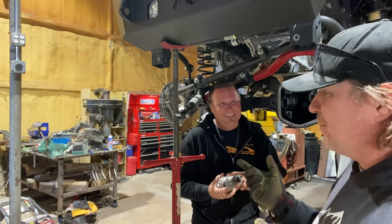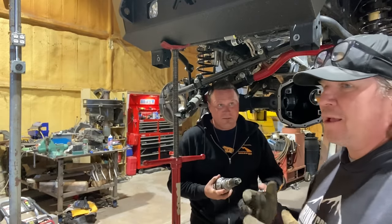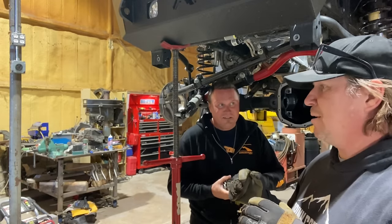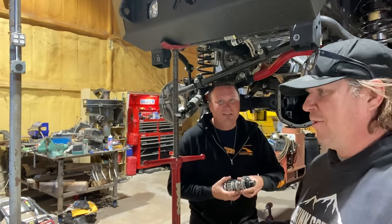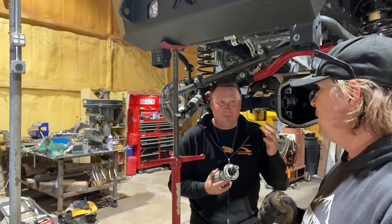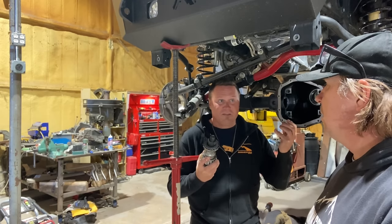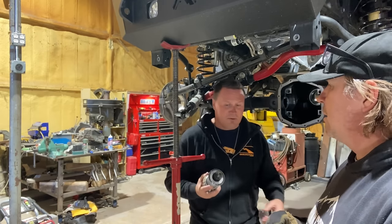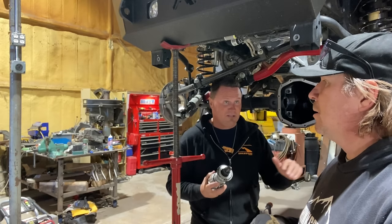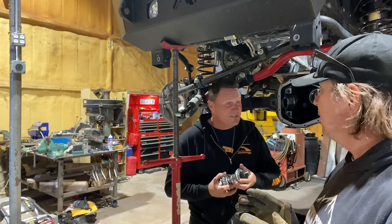Oh, and that's another thing that's important to tell people, is that the ring and pinion, they're a pair. They are a match set, yeah. They're like a monogamous relationship. They're like two Canadian geese. You have to keep those two together. You can't take a pinion out of the pile and a ring gear out of the pile and just throw them together. There is a little more science to it than that, and you kind of almost can, but they would have to be all from the same run. Most people don't know that. They think that this one and that one were matched together. They weren't. They were actually on the same machine at the same settings, but that ring gear went over here and this pinion went over there, and eventually they were put in the same box. So they're only a matched set to that manufacturing batch. It's like a pair of Canadian geese from a specific part of Canada.